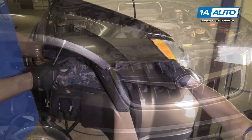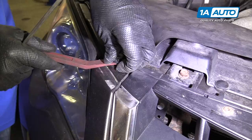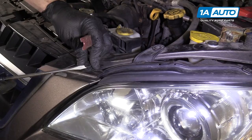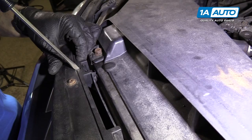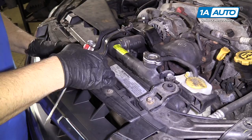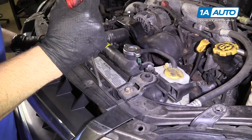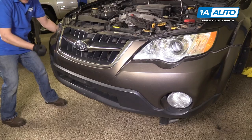We're going to pull these snaps out. There's a flat blade tool on our trim tool for this one too. Pull that out. Right along here, these little clips — you push these down and pull out on the grille, just like that. Now we're going to grab the bumper. The whole bumper should be loose now — pull it right up.